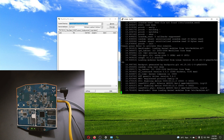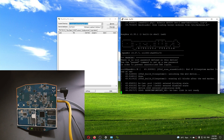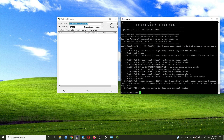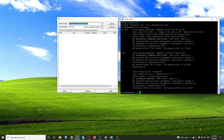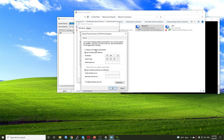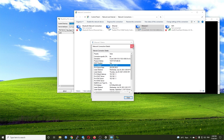Looks like the installation process is finished. I will press the Enter key — and here we are: OpenWRT 19.07 running on the Aruba AP105. As always, I will set a root password for the AP. We can see from the ifconfig command that the default LAN IP of the router is 192.168.1.1 and the DHCP server is running. I will change the network interface of the PC to DHCP mode and we should receive an IP address from the AP105. Let's log in to the LuCI web GUI.